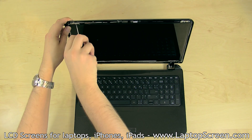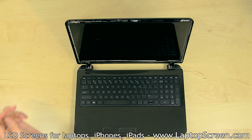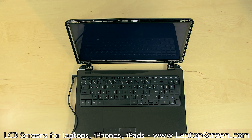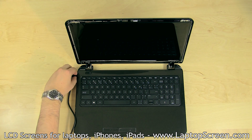Replace the front LCD mounting screws at the top and in the bottom corners. At this point, we can test out the new screen. Reconnect the power cable, turn the laptop on, and if the startup graphics appear, the screen is installed correctly. Hold the power button to cancel the boot up.